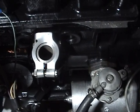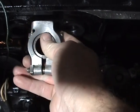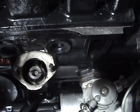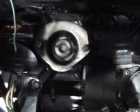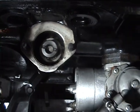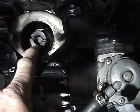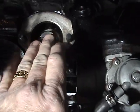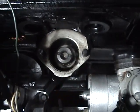The other thing I wanted to show is this distributor. If you pull it, you're going to see the distributor gear down at the bottom. Looking at its position, it's just above nine o'clock and just below three o'clock. Also notice the top half of this circle is smaller than the bottom half — this small half has to be on top when you're at top dead center.